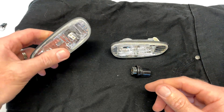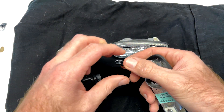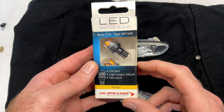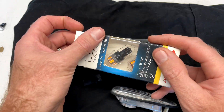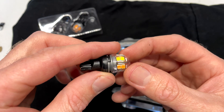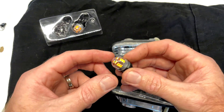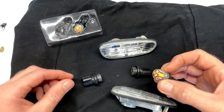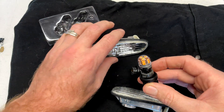It's actually really hard to get decent amber LEDs in a T10 — there's just not much available in a good quality one anyway. So let's just pop them out. I've got these JW Speaker T16 amber LEDs, and if we have a look at these in comparison, there are many more individual LEDs in these bulbs, so they're going to throw much more light. They're also going to throw light sideways to reflect off the inside of our lamp.